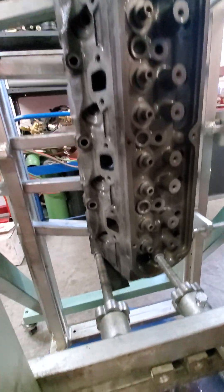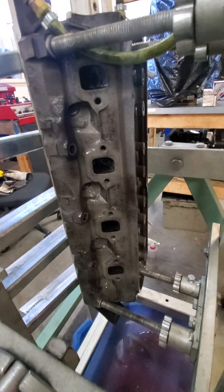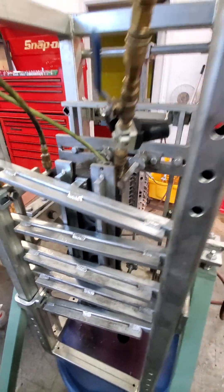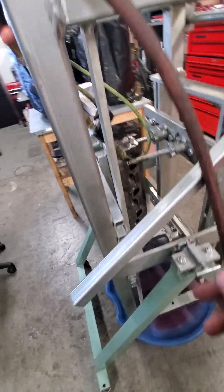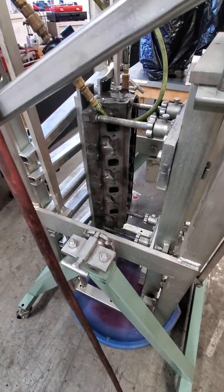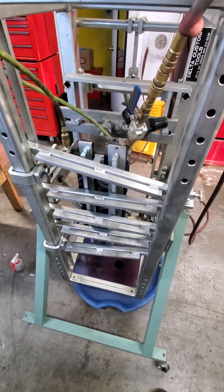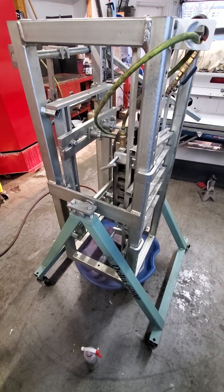I'm confident that these aren't cracked. I usually find a crack with the particle mag. Now I'll roll that over and throw that wet soapy head in the spray wash with the other one, give it a quick rinse, dry it off, and I can commence rebuilding it. But there you go — for those guys that are interested or just unsure what this was, that's a pressure test. Thank you.